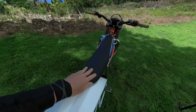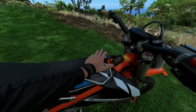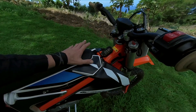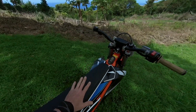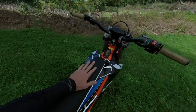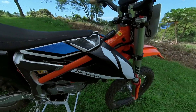The seat seems fairly comfortable but it's very flat — that's one thing that makes it feel like it handles weird when you first get them. There's no curve in the front, so when you go to corner you tend to get a little bit too far forward. On the stock suspension it's very soft so it makes the front end dive. That's just a learning curve for riding these bikes — it's not a big deal once you figure out where you need to sit. That handling issue goes away, especially if you have the suspension beefed up.